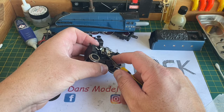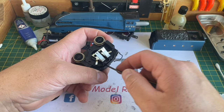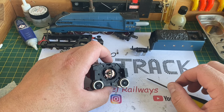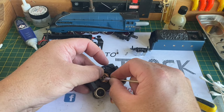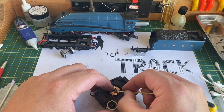The other spring comes out but the other brush is stuck solid in there on the commutator, so we're going to have to strip this down and clean it all up. Gently unclipping the motor faceplate, you can see there's the errant brush stuck in loads of gunky, horrible carbon and old grease. The commutator, though it looks shiny, is actually quite dirty. Initially I use a cotton bud and methylated spirits to remove some of the dirt, and then to polish the more burnished parts of the commutator faceplate, I use my fibreglass pencil to clean off all that old carbon.